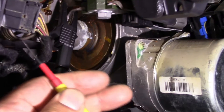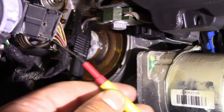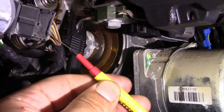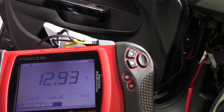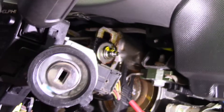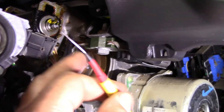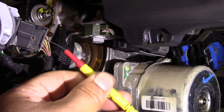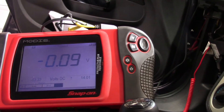Pin number 2 is here with the red and violet color wire. I'm going to back-probe this and see if there is any voltage available. I have back-probed it and as you can see it's 12.93 volts — and there is no key inside the ignition. Now I'm going to check circuit 50, which is pin number 4, and back-probe it to see if there is any voltage. As you can see, there is no voltage available at this point.